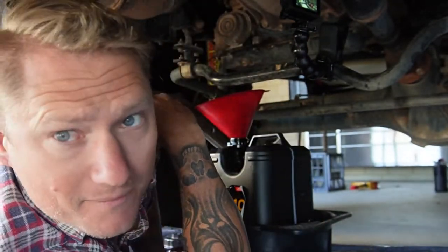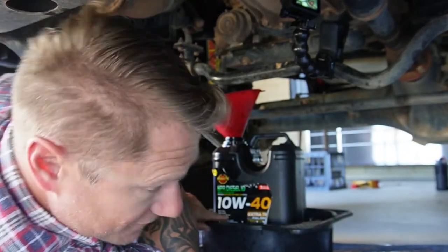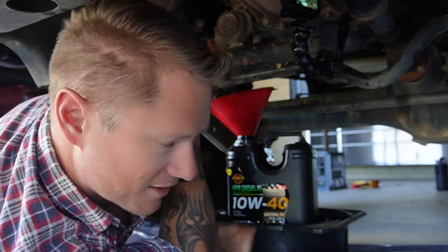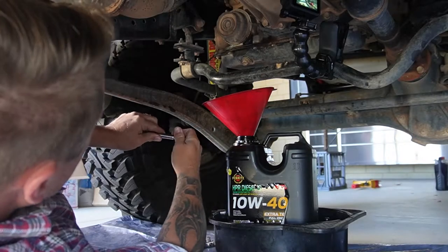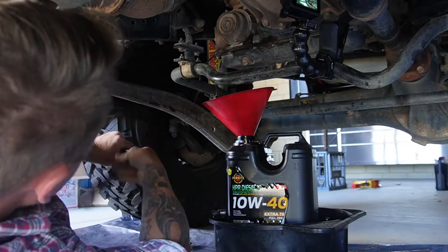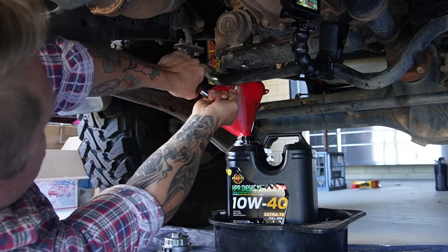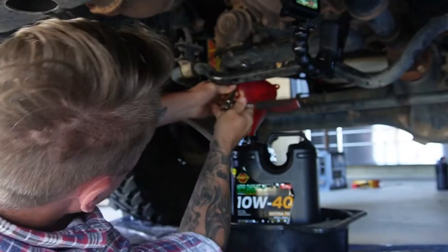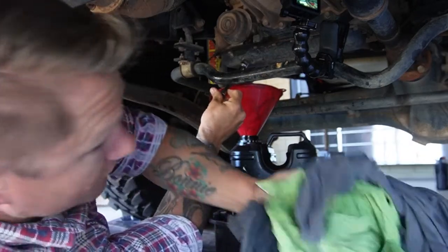With the 14mm socket I'm just going to drain the oil out of the sump. What I've got set up here is a funnel going directly into the old 20-litre drum. I'm just going to loosen that off and hopefully catch all the oil — key word is hopefully. That was a little bit tighter than I'd hoped. I've got a whole heap of rags here as well.